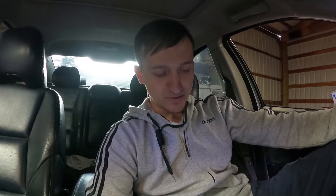I'm so happy! This car would cut boost when you started accelerating and do random stuff. I repaired a lot of wires — whatever looked suspicious I repaired. Now I'm going to get some plastic wire loom tubing and put it over the wiring, renew the insulation. The MAF reading dropped to 20 now. I'll go for a test drive to make sure everything's good, and maybe pull out the ABS module — but I need this car Monday for work.